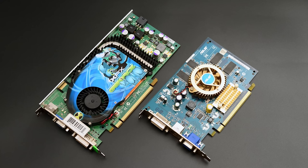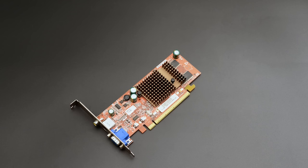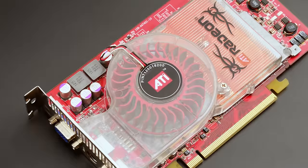As far as Windows 98 is concerned, Nvidia only provides drivers up until the last graphics card of the 6000 series. From ATI we have the passively cooled Radeon X300SE, an entry card, the only one in our list today that only has one connector. The other Radeon we have today is the X850XT that is placed in the high segment as performance goes.